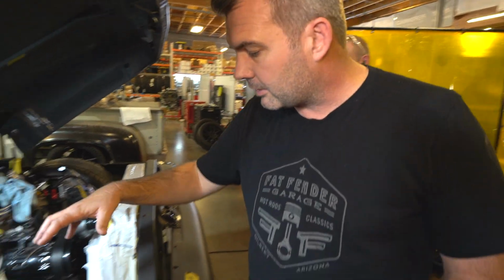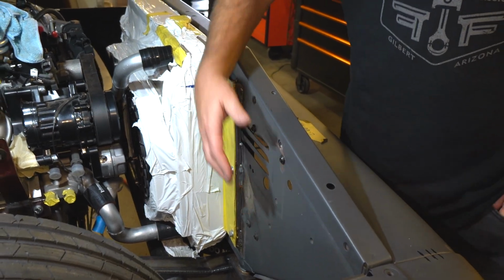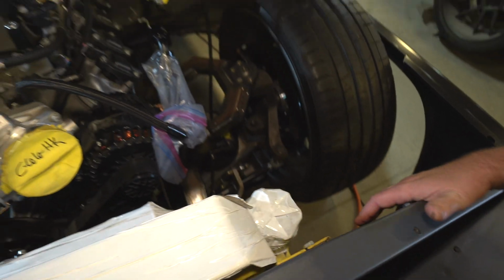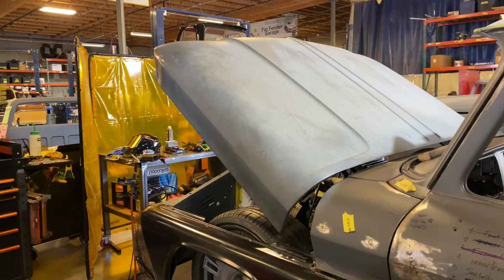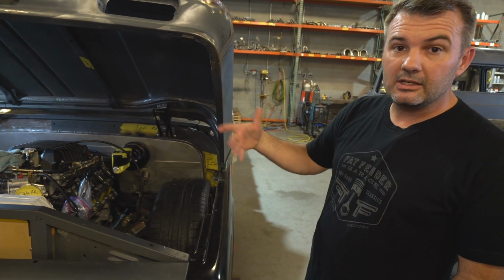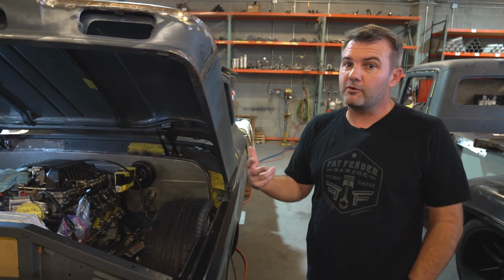Right now, he's going to have to work on building the supercharger coolant tank overflow here. And then we've got cold air intake right here. It's going to come over and kind of come down right here. And we'll pick up some fresh air right here. This will all be boxed in. Once we have those components, then really the main thing that's left is really just the fenders and a cover. Then we can kick this thing over and get it in the body shop. It's a brand new crate LSA from Chevy, which you can't get anymore. These are like one of the last ones. Basically they said we're done with the LSA for aftermarket. So now you got to use like the LT4, LT5.